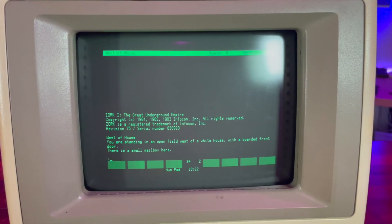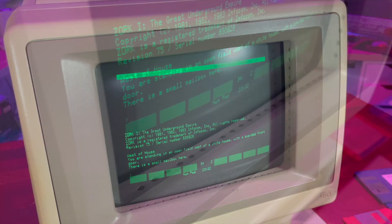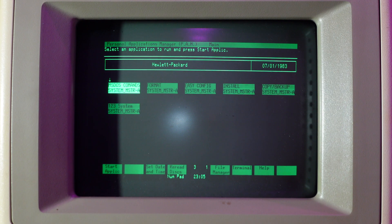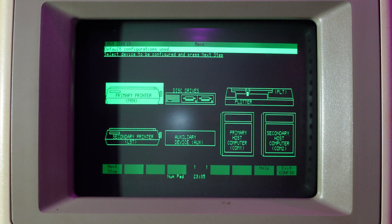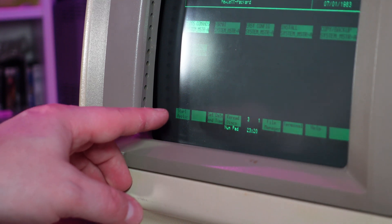The answer lies, quite literally, in the rather chunky-looking bezel surrounding the screen. View it at a slight angle and you immediately notice these holes in the bezel. These contain rows of infrared transmitters and receivers, which form a grid on both the X and Y axis. These pass beams of invisible light from side to side and top to bottom, and when you interrupt those beams with a finger — or any other implement — the 150 is able to interpret where the user was intending to touch the screen. In fact, you don't actually have to touch the screen at all to register the input; you just need to break the beams in the right position.